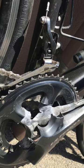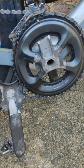What's the issue? Well, it appears water getting inside corrodes the bonding agent between the two halves. Annoyingly, Shimano have never officially recognized the problem, but they have resolved it on the latest cranks at least.